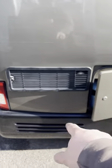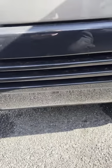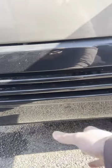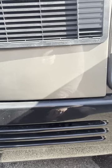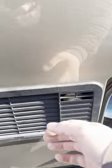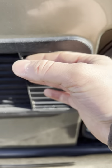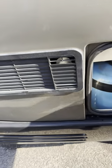The fridge sits just here and you've got two vents for it. This little bit just down here is because the fridge needs a little bit of air to get to it. When you have the fridge lit up on gas you should be able to feel a little bit of warm air coming out through this little vent — which proves that the flame is definitely working.